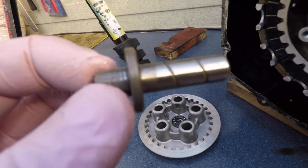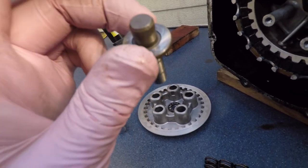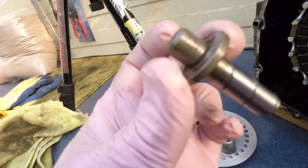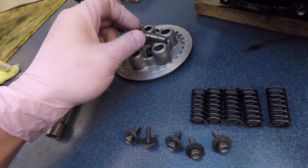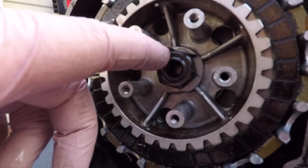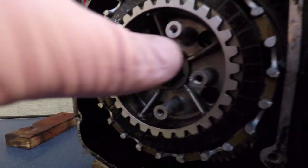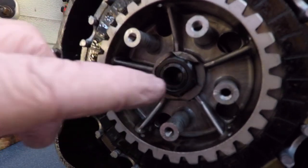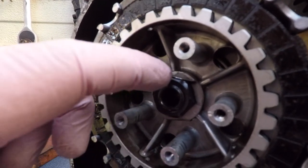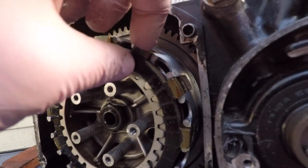So, the shaft on the inside has got this thread-looking thing. I'm guessing like a pump for oil. And on the outside, on the cap side, is the short shaft. Now, this has a giant nut to remove this casing wheel. Got a giant nut here with the same safety thingy. So this has a washer, and the washer is bent here to keep the nut in place. The discs should come out, and they do.